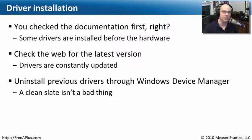You may also want to consider uninstalling the drivers in Device Manager and reinstalling them again. Maybe something didn't work right the first time. Maybe when you installed them initially, you didn't have administrator rights — get the proper rights and permissions and then install the drivers again, making sure all the files are copied to the right places. If you completely remove those drivers, it's a clean slate and you can reinstall to make sure everything works correctly from the start.